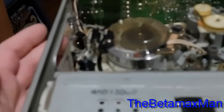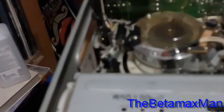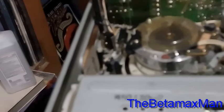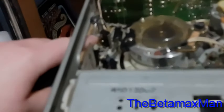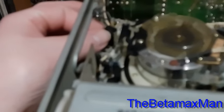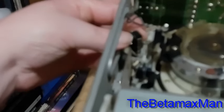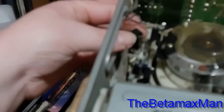What I'll have to do is loosen the screw — we'll move the switch, loosen this screw here on the switch, and it'll allow that switch to move in whatever direction we need it to. Typically this is set from the factory, and it had a dot of paint that the factory put on the screw. I've loosened the screw so now I can physically move the switch forward or back. You can see I can now swivel and move the switch to whatever position is needed.